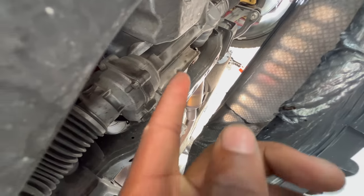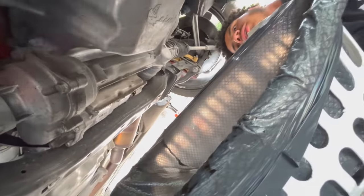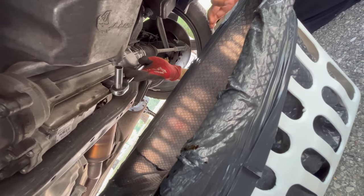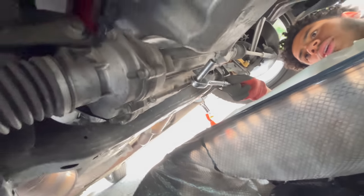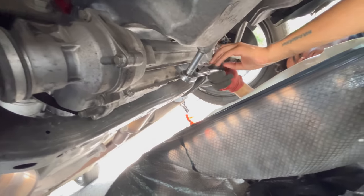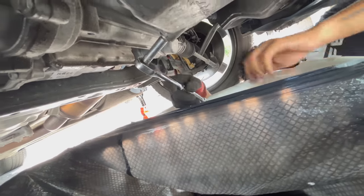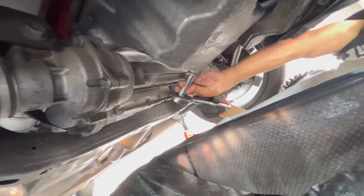So now you take the ratchet and unloosen the 13 millimeter bolt. Where's the 13 millimeter bolt at? Right there on the oil pan. You see it on the back? Oh, I see it. The oil drain plug? Oil drain plug. Here, let me see. I got you. Now unloosen it by hand the rest of the way. Take it off of the ratchet.